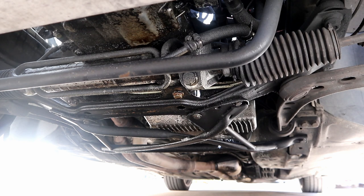For 10 months of daily driving this thing multiple times every single day, this actually isn't that bad. It was about maybe a quarter of a quart low. I do run a lot of oil in this motor. These motors take, I believe, 6.5 quarts out of the gate. I am running an oil cooler on this that takes an additional 2 quarts of oil, and pretty much all of my motors are a quart high anyways. So instead of 6.5 quarts, I put 9.5 quarts in this.